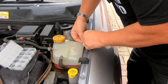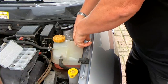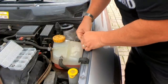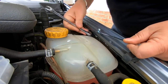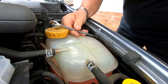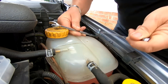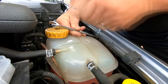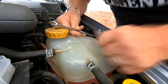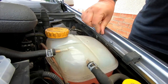Then go underneath - you want your washer underneath there. Put that through there, a little bit fiddly with that bolt there. Get the nut underneath there. I've got a 10mm spanner for the top and a 13mm one for the bottom - that fits perfectly. So if you're going to do this folks, get a couple of spanners. We're just going to tighten down on this. It was definitely a good job to put that extra washer on there, because it does look like it would have pulled through. That's it, done. So there's the first one on - let's do the same over the other side.